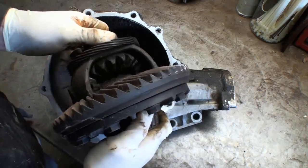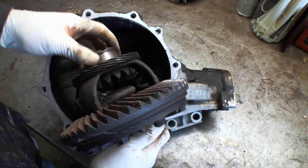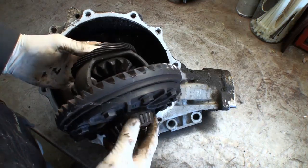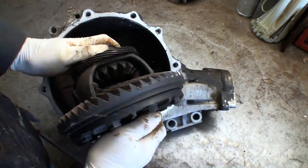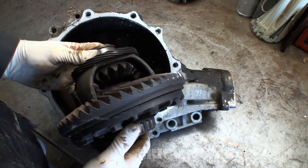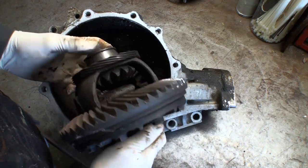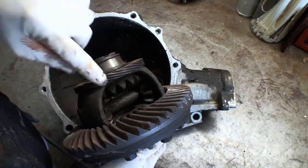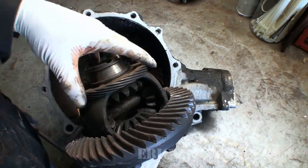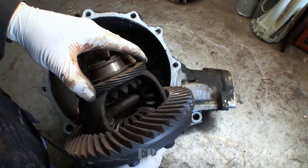What I believe is happening inside our Subaru is these bearings. This bearing is completely gone, and here's its old race. That's basically what supports the whole assembly inside the differential housing. What I'm seeing with those shafts coming out of the differential on the Subaru is a lot of play back and forth, which means there's quite a bit of slop where these bearings are. This gear around the outside drives the speedometer gear — this being the final drive assembly is normally where you take your speed signal from.